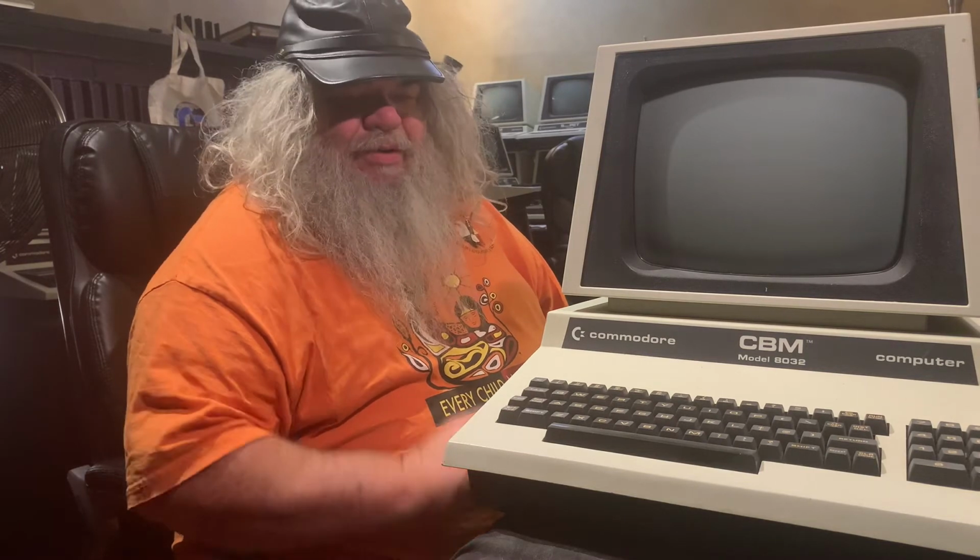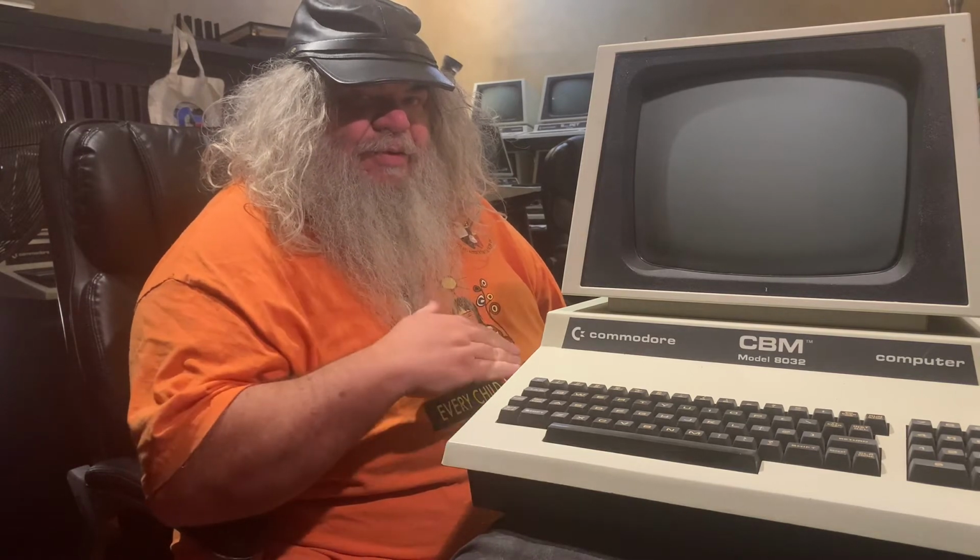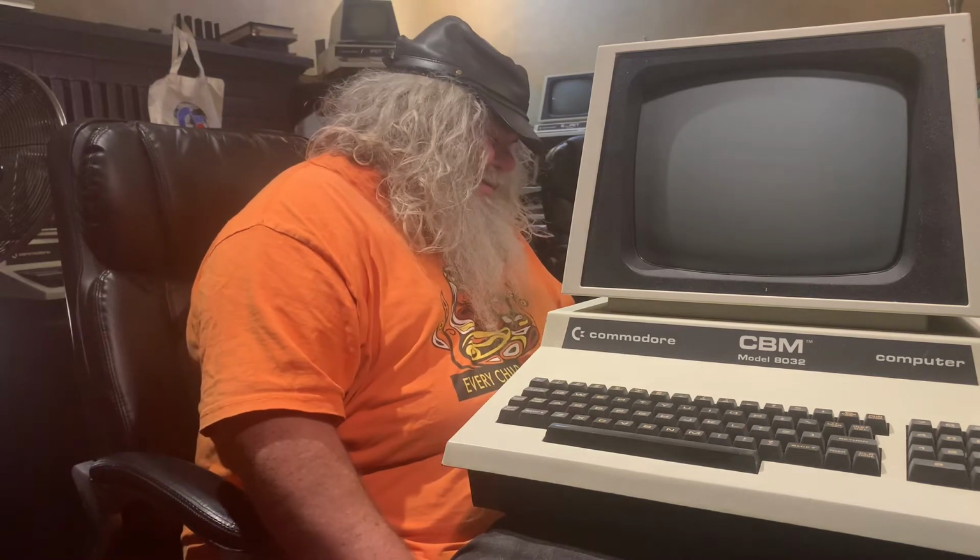I had one, if you plugged it all the way in and down and happy and joyful, after a little while, it would turn off. But it wouldn't turn off, you couldn't see it. See, if a monitor is turning off and then back on, it will slowly come up. If the connection to the signal is wonky, it'll just go on and off, on and off, on and off. There's no warm-up period because the monitor is still on.